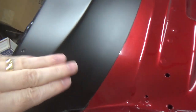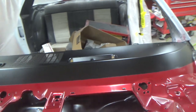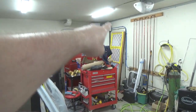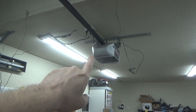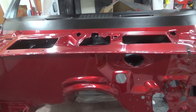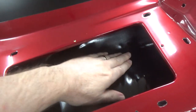There's a tiny little bit of trash in the finish, but you're hard pressed to see it. I tried to be really careful about that second application. I cleaned everything down, sanded it, covered everything up with paper, wet the floor down, and taped every hole I could find. I also moved the car — I realized I'd been painting right under the garage door opener, which is probably the dirtiest place in the shop. I also put some epoxy inside to seal that up well.